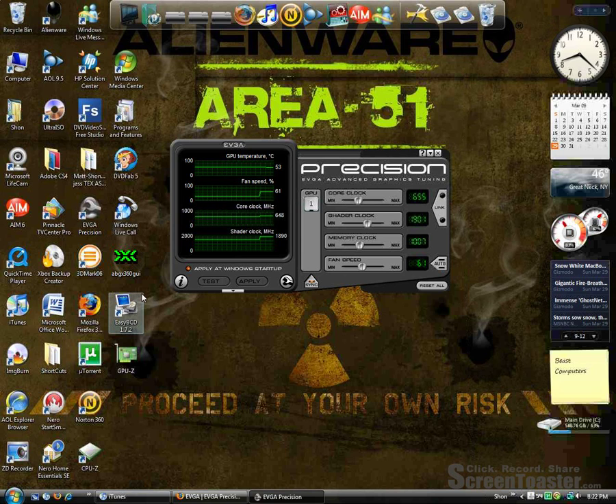By the way, when I was first overclocking this thing I did it a bit too far. I wanted to go see a movie, for example, and the movie would freeze over. If this happens to you, you've done the same thing — just restart your computer, go back to EVGA Precision, and click Reset All. And then you'll be good.